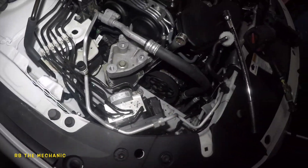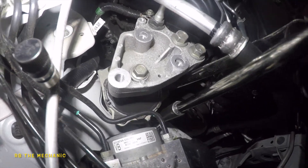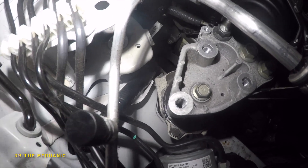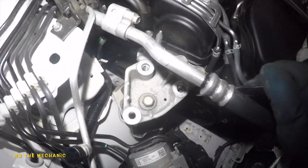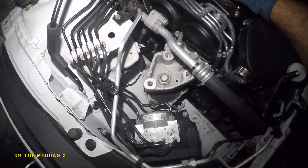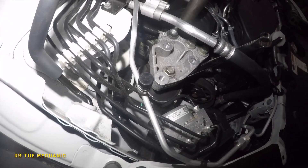What we're gonna do is reach down here — 17-millimeter down here. And then we got another 17 all the way down there. There you go, so far looking good. Save the bolts, don't lose them and don't lose the order. My tensioner here is sitting against the engine mount, so it should come off once we take that off. Let's switch sockets one more time — this is a 19-millimeter. So three bolts — one, two, three — remember your engine is resting on the jack.